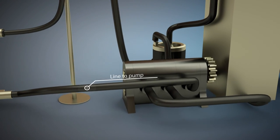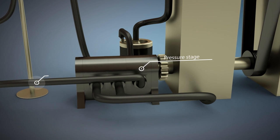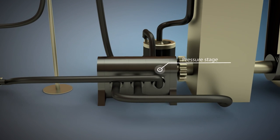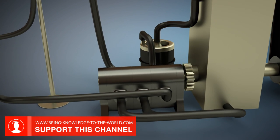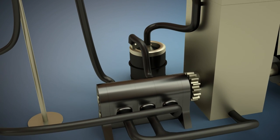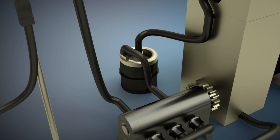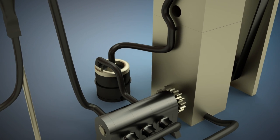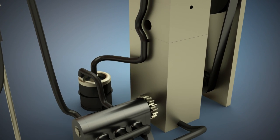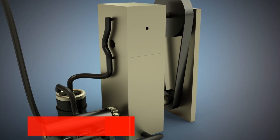The oil tank is connected to the pressure stage of the pump. The oil is pumped by the pressure stage to the oil filter, which helps remove contaminants from the oil. The oil then lubricates the engine parts and drips or flows into the oil pan.